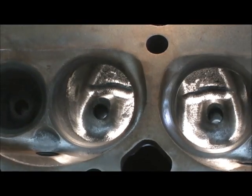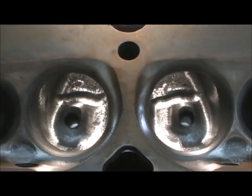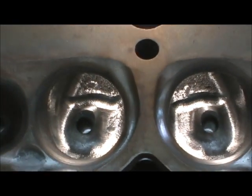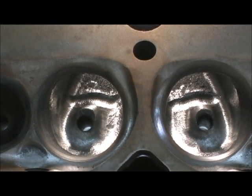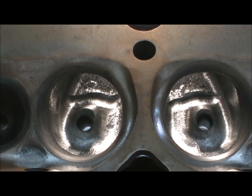But that right there sets both of them. They're pretty close to the same. Let's get a close-up look at it. That's about as close as I can get you without fogging. I can tell you right now that I have raised that roof right at 100 to 125 thousandths. I am not going to go no further than that because I am playing with fire. If I busted through I'd have to stop, and after the coating's already applied — which is something I don't normally do — if I had to weld it, it would burn all the coating off. So let's just be careful. That's what I wanted to show you.